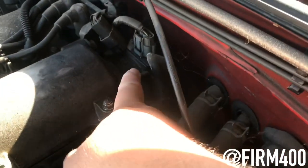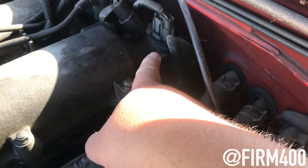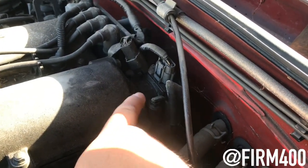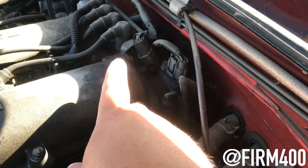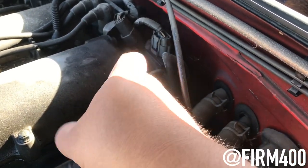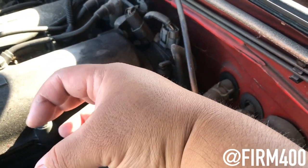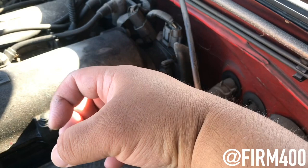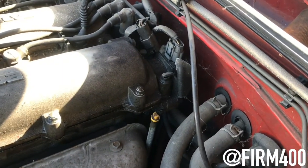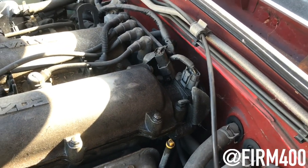Right here, as you can see, this bad boy right here — the crank angle sensor, the O-ring — I believe that O-ring is bad, so we're going to change that too. We're going to have to remove some bolts to get that O-ring out and replace it. We also need to make sure we leave the position of the CAS the way it was originally so we don't have to deal with any timing reset issues. That's going to be our main priority.